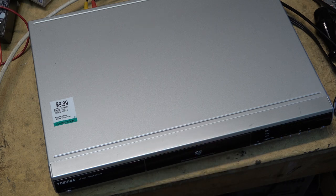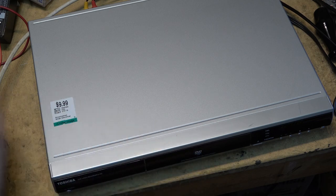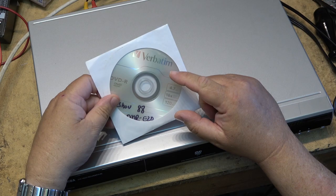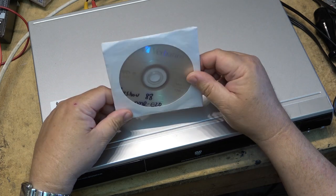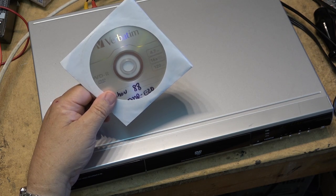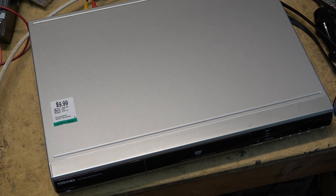The data from the tape is transferred over digitally — the DV data is fixed compression at 25 megabits, reduced down to five to ten depending on recording speed, but it's all done digitally with no analog translation and the quality is very good. People say why do people want stuff on DVD anymore, but I do a lot of archiving. Nine out of ten of my customers still want material put onto a physical disc — a lot want it on a USB stick as well, but the vast majority want footage on a physical disc because data on a memory stick or hard drive can easily be corrupted.